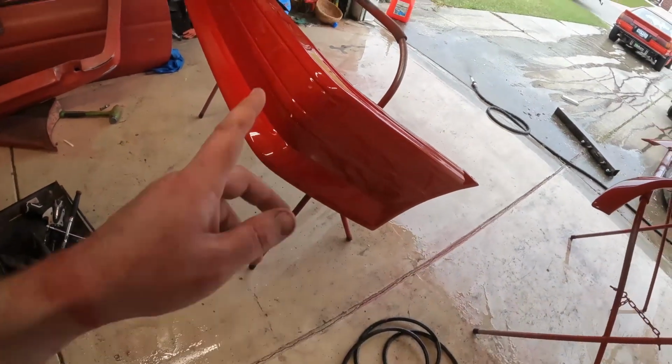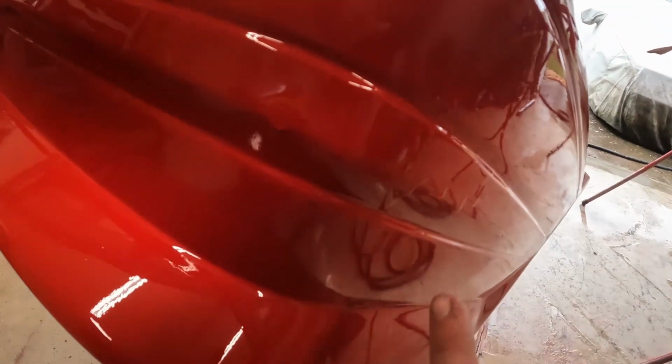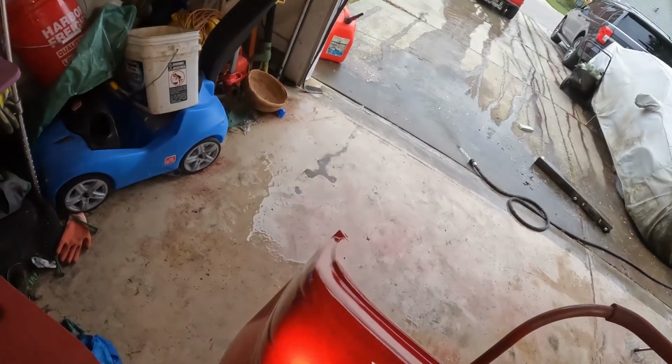But I also get carried away with clear coat. So the paint went fine, started clear coat, and usually I'm like, okay, I need to stop. Then I'm like, no, I want one more. And it's the one more that gets me, because I lay it on too thick and then you get crap like this because I'm an idiot. So right here, there's a nice big sag in the paint. Hang on. All right, the rest of it is okay, except some dirt got in it. And then a nice big sag on this corner here too. So, oops, but at least that's done.